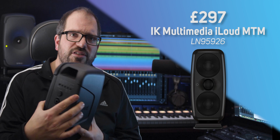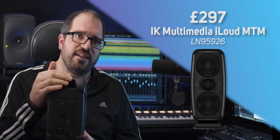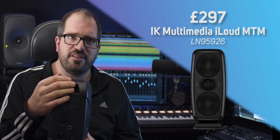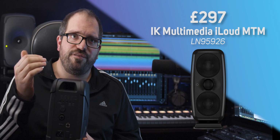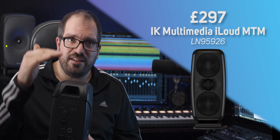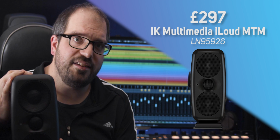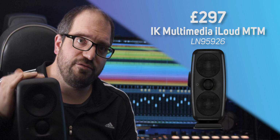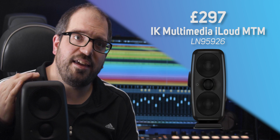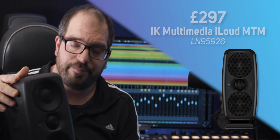Now, the port on the back can get a little bit noisy on the lowest bass settings with the lowest notes, but you can stop this by using the 50 Hz cutoff instead of 40 Hz, or just mixing slightly quieter if you're on that setting. These are fantastic for almost any space. The calibration's really easy to use, and they make it easy to get the best out of even the most challenging space. Next up are kind of the polar opposite.